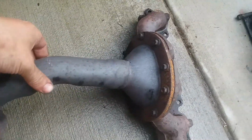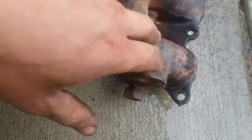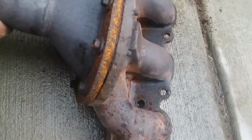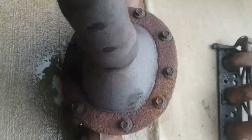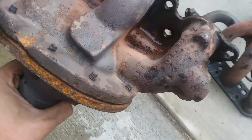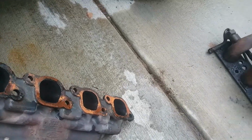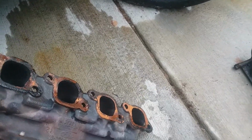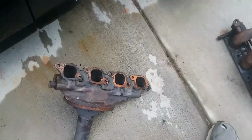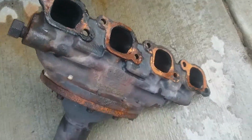often called the pancake manifold, because it's got this real nasty cast steel top half that's bolted to a giant round collector, and from the side it kind of looks like a stack of pancakes. And this sucker is heavy, being all cast at the top, but being cast, that makes it cheaper to make. Makes it really hardy, but it really cuts down on performance of the flow design it has.